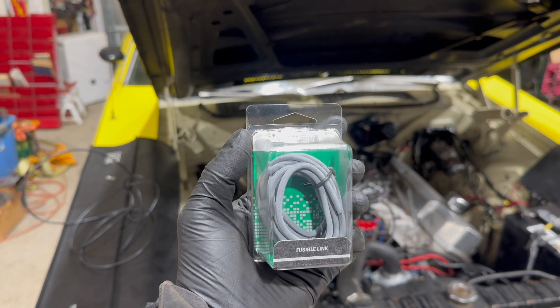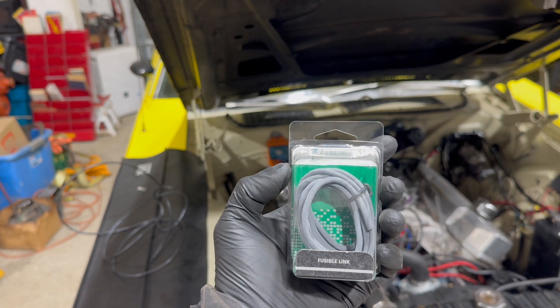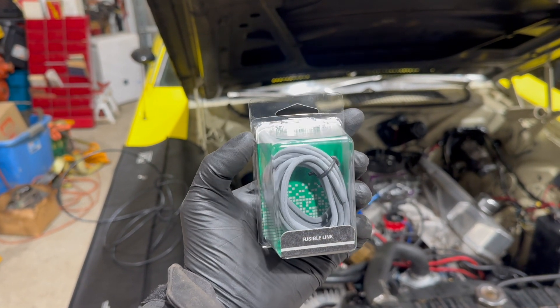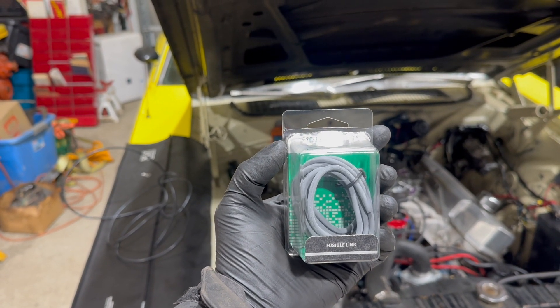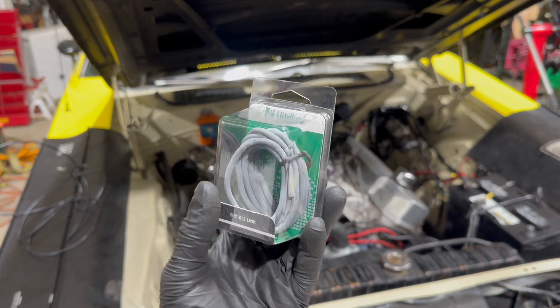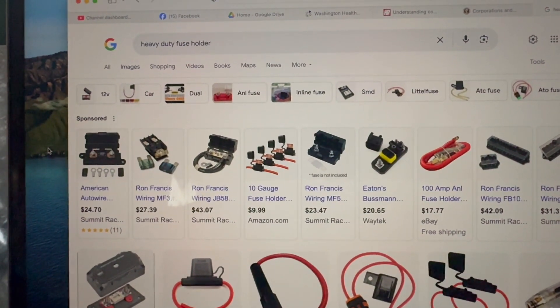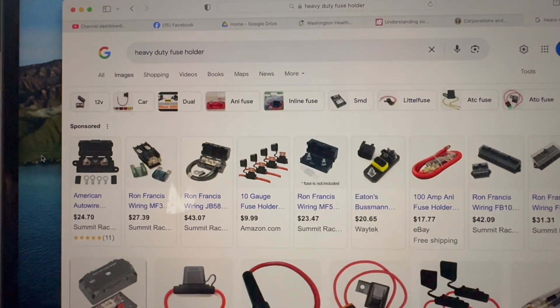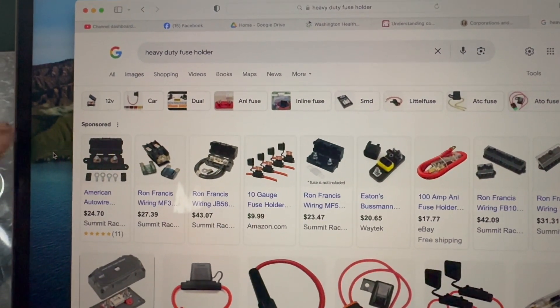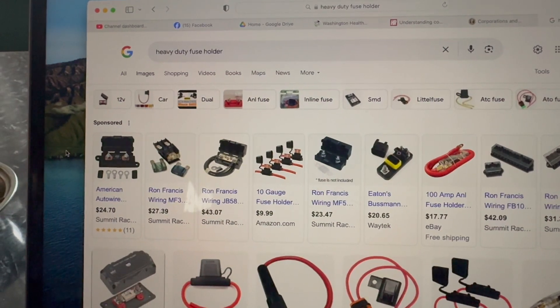The factory electrical system is protected by a fusible link. There are fuses for some individual circuits, but the headlights and the ignition among other things are not fused at all. So if there's ever a meltdown, or if there's ever a failure in one of your fuses to blow in the event of a short — which happened to me once — the fusible link is there to prevent the car from going into full meltdown. Sometimes it even succeeds. When we add this charge bypass wire, if it goes straight from the alternator to the battery without protection, there is an opportunity for a short inside the alternator to burn the car to the ground. So at the battery end of our wire, we will be including a second fusible link. I like to use the fusible link because it blends into the atmosphere of the classic Chrysler engine compartment. But if you would prefer to use a fuse, you can — there are lots of options available for different inline fuse solutions. You could get a trick little fuse holder from American Auto Wire, for example. You want to make sure that whatever fuse you put in there can handle the charge output of your alternator.